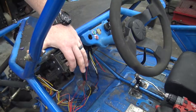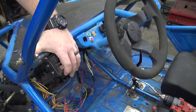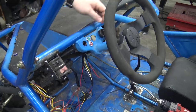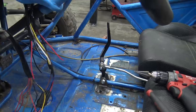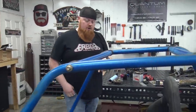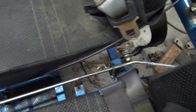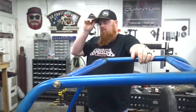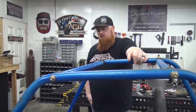The starter solenoid is almost bad — it'll work sometimes, won't other times. So I'm going to buy a new starter solenoid. The headlight switch works but we haven't ordered headlights for this thing. Daniel built that beautiful shifter — that's a Honda Civic shifter. He used Go Power Sports 3/8 tie rods and ran them back to the engine, bent them up. Looks really nice and it has a bunch of adjustability to it. Since it's tie rods, you can move stuff in and out. Works really good.